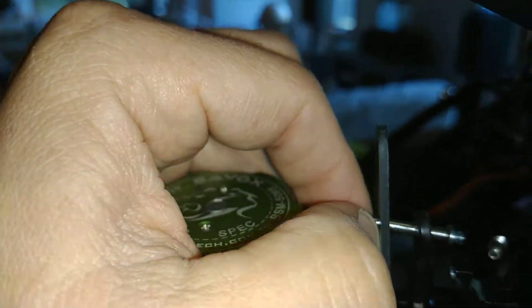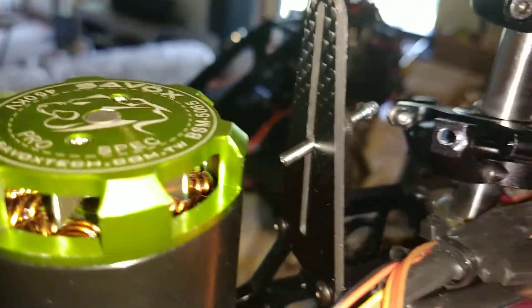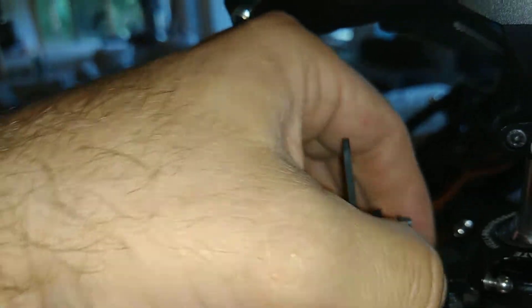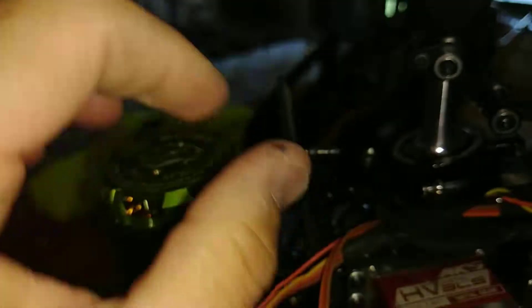The anti-rotation pin — I don't know what the hell they're called — ripped right out of the aluminum. The aluminum became deformed, so it won't screw back in. I could use green Loctite, but that's a little iffy on a 700 with that much force. And if that breaks mid-air, it's not worth it. A new one's 50, 60 bucks, and they're not in stock, so this thing is down for a while.